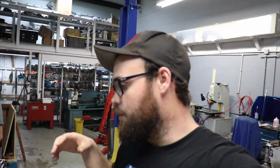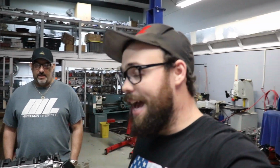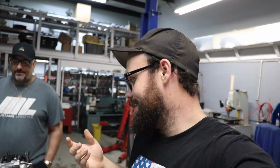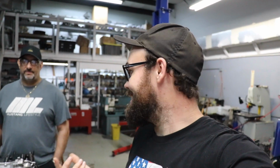So we are starting off once again here with Jordan, and we're gonna be tearing it down to see what went wrong. Now I have a few theories, Jordan has some theories, Lewis has some theories, I think Sam, Lewis's tuner, has some theories, but ultimately it was probably running a lot of boost on a cold night with 93. That's an equation that is not really good, but my guess is that it blew a head gasket, induced water into a cylinder, and bent a rod. But we will see once we get this torn down.